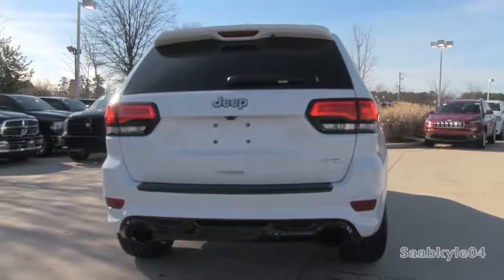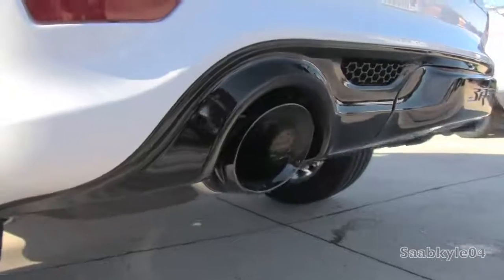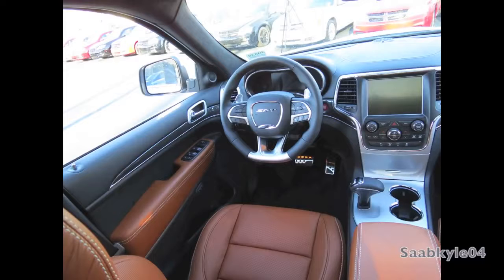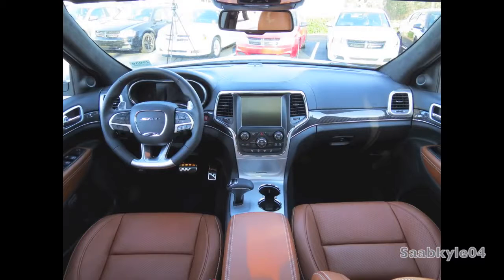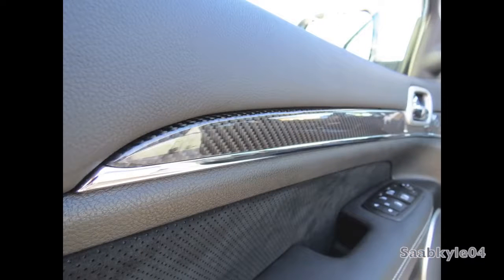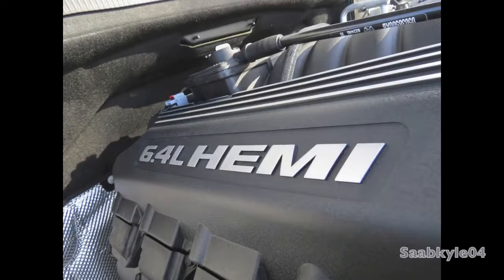All in all, it can transmit up to 70% of the vehicle's available torque to the rear wheels while in track mode. In sportier settings, it also relaxes the various safety measures, but still retains some anti-roll and stability protection, being that it is a larger SUV and not a sports car. It also uses sensors to detect wheel slip and is able to transfer up to 100% of the vehicle's torque to whichever rear wheel has the most traction. It's not necessarily a torque vectoring system, but it can predict the possibility of wheel slippage based on road conditions, and therefore anticipate torque transfer before it's actually needed.